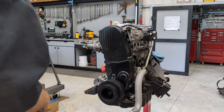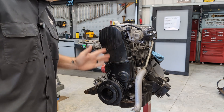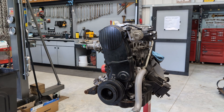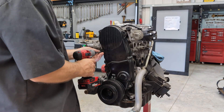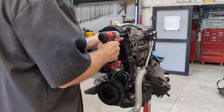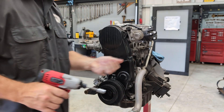One of the first things I would do is get the engine in time. So the first thing we're going to do is take off this top timing cover — 10 millimeter bolts. Three of them are the same size, these first three, and this one here is longer. So there we go, I'm going to take that off.